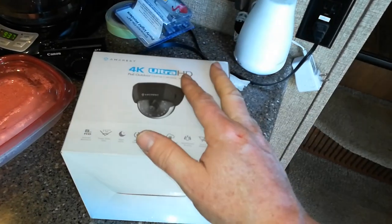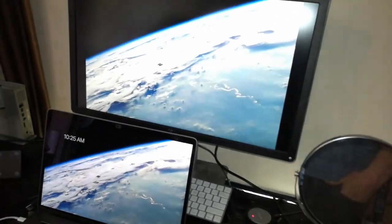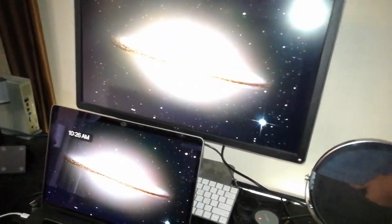The only thing is, I'm probably going to have to upgrade my computer. That's the little computer that I'm using. It's a Zotac ZBOX. It's got an i7 processor, fifth generation in there. But it's not going to be able to crunch all that video. So I'm going to have to use the Blue Iris direct to disk option, so it doesn't use as much CPU. But yeah, it's with a 4K camera, and then I've also got a couple others like that. It's just going to be a crazy amount of bandwidth, and I hope that it can handle it.